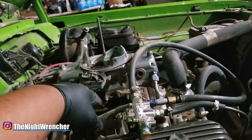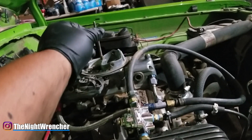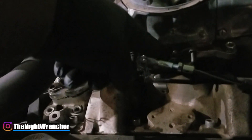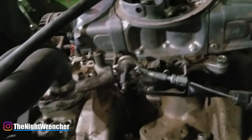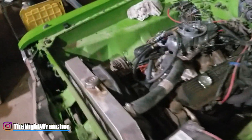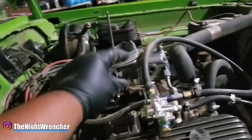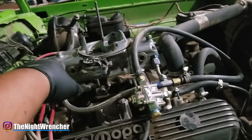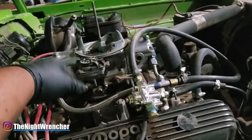If you can't get your car to idle, go ahead and turn up the idle speed screw. This is where a lot of people try to set up their idle and it ends up ruining the whole carburetor experience. A lot of people set up their idle using the idle speed screw - that is not the correct way. Just turn it up to get the car to idle, because otherwise you won't be sitting on the idle transition circuit, you'll be sitting more toward the main jet circuit. Just get it around 1500-2000 RPMs and let it fully warm up while you set your floats.